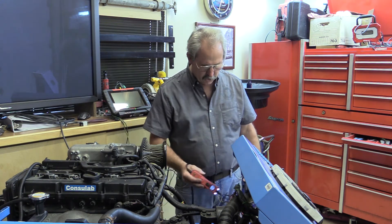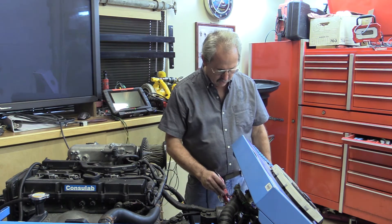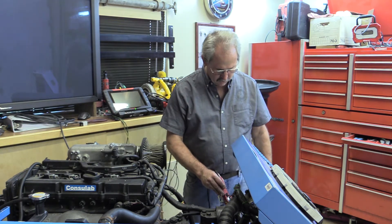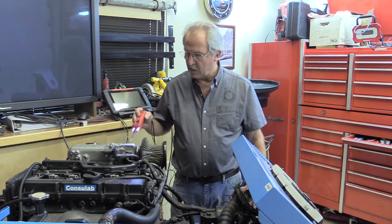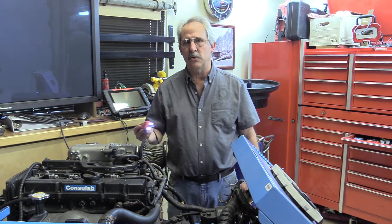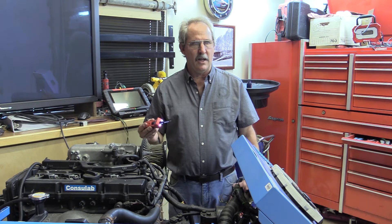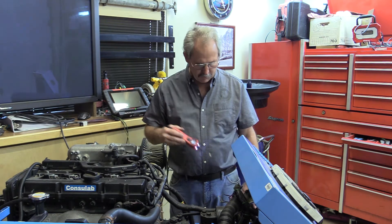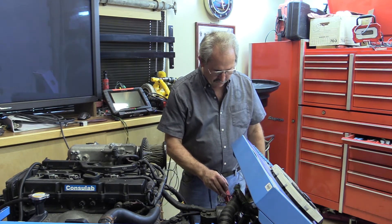These are great for testing fuses, because if I test a fuse I should hear the same sound on both sides. If I hear a different sound, they're electrically different, which instantly tells me I have an open at the fuse. I also have the LED lights, which are great in a shop environment where there's a lot of noise and lighting might not be real good.